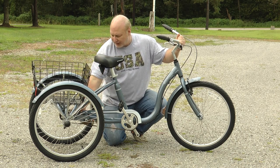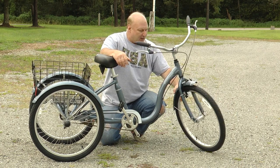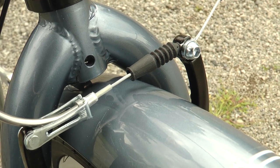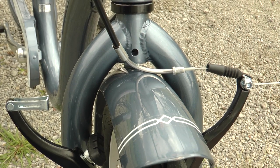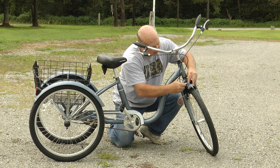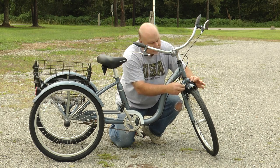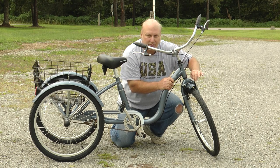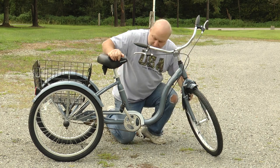Once you get your rear axle assembly put on and the two back wheels on, the next wheel you want to put on is the front wheel. To do that, you're going to need to push the top of the brake together, which will let you disconnect the brake. Once you disconnect the brake, the tire will just slip right up through, and when it's time to put it back together you just push it together at the top and it slides back in. You may have to do a little adjustment on your brake — there's an allen bolt which is metric, and you loosen that and then either pull the cable or let it go through to make your brake either tighter or further away.